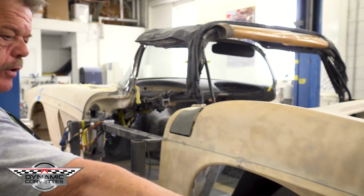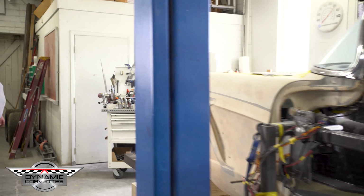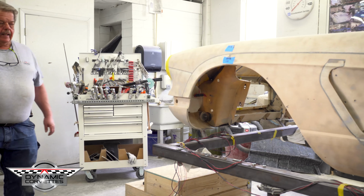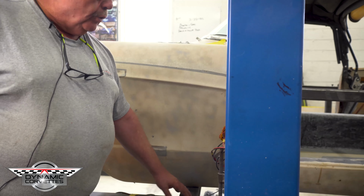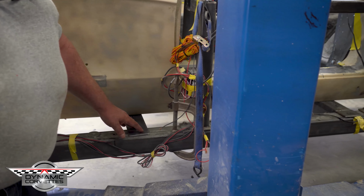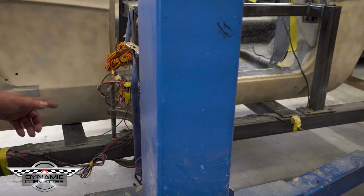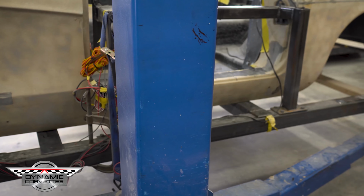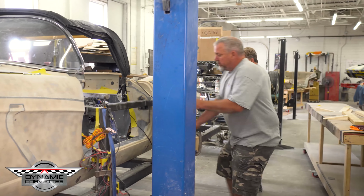The back of the car is suspended to our fixture, and the front of the car is suspended to the fixture. So this is holding this body. This body's been twisted around upside down and everything you can think of, and it hasn't moved. So we've also built two more fixtures that go underneath this that's gonna hold our floor. We're gonna drop the floor down. We're gonna bag our epoxy, mix up our epoxy and put it in our bag and squirt it in there. Then we're gonna put the floor back up to the bolts, bolt them snug, and then put our wedges in there with our other fixtures to hold it and walk away from it for the day. So go ahead and drop the floor, Todd, and Andrew can show that being done.